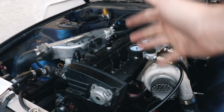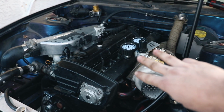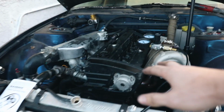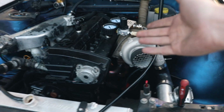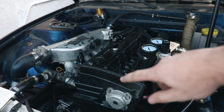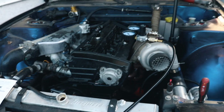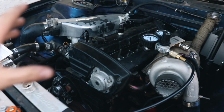And I wasn't hearing it from anywhere except very faintly from the dipstick. And as you saw from the numbers, cylinder 3 lost the most at 4 psi, which is like nothing. So that confuses me when I look at the numbers from our compression test, because the numbers from our compression test showed that we were between 130 and 135 for all 6, when we should be at 160. So I think that it was the AutoZone compression tester that we used that was giving us a super low reading, which is amazing news.